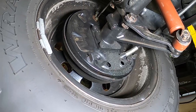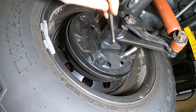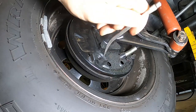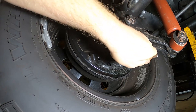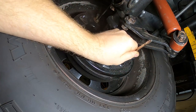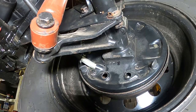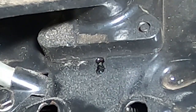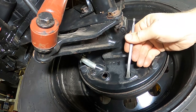This doesn't look too good — I'm pretty sure that's transaxle fluid and I don't like seeing so much of it. This is the weep hole here; we may have to investigate that separately. For our purposes though we're here to tighten up these adjusters, so a couple of clicks there and a couple of clicks here. This side gives you a better look at the weep hole in action — not as big of a mess over here, but definitely some fluid coming out, so we'll keep an eye on it.